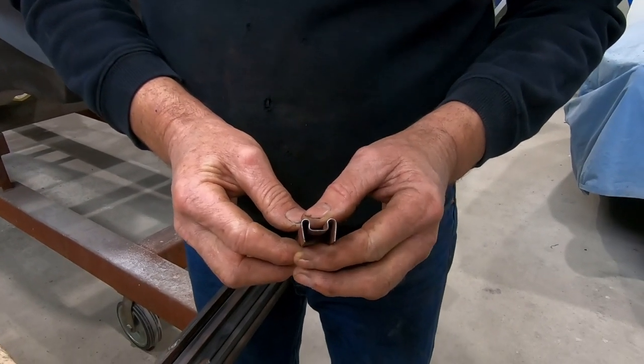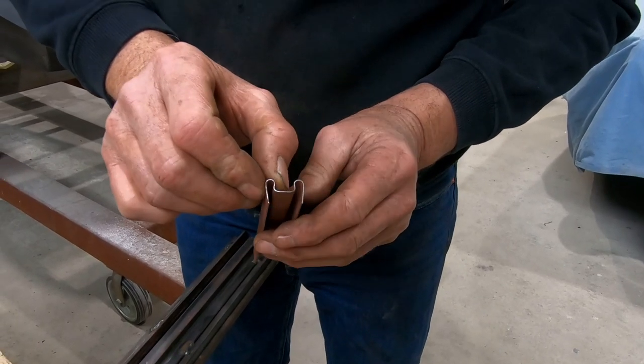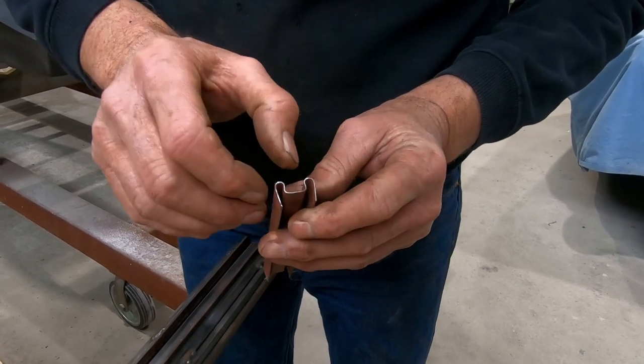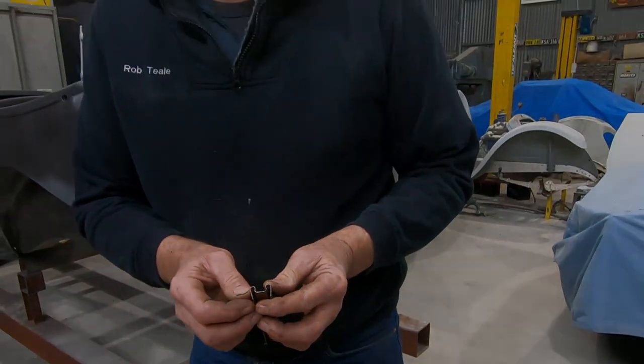So this is the basis of our shape. There's our channel for our glass to sit into. These areas here are much too wide compared to the original, but from here I knew I'd have to go to the Pullmax and actually feed this in here and reshape these sides a little bit. So I've made some unique tooling for that, and we'll go and do that now.